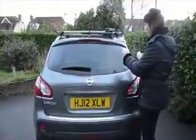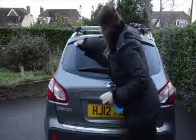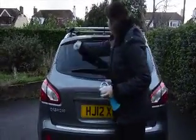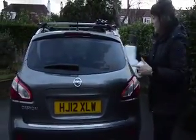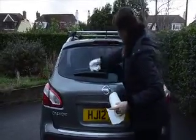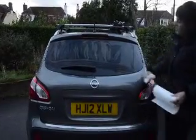First thing to do is to make sure your window is really clean. I'm using just clean water and a kitchen towel. If you've had your car washed in a car park, you may have got silicone on the window. If you think this might be the case, clean the window first with lighter fluid. Make sure the window is thoroughly dry before you start applying the decals. It's also best to choose a still, dry day.